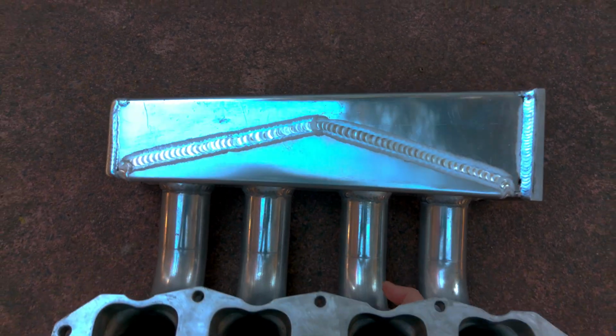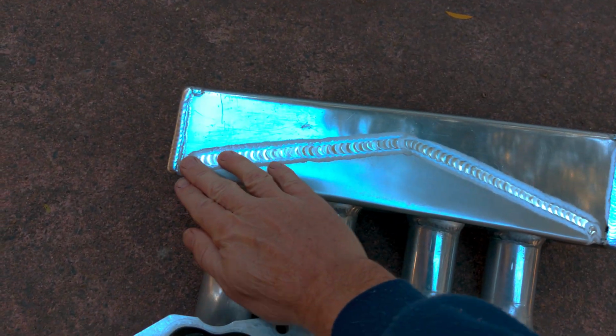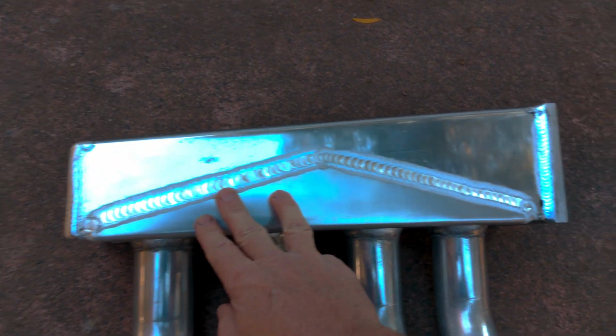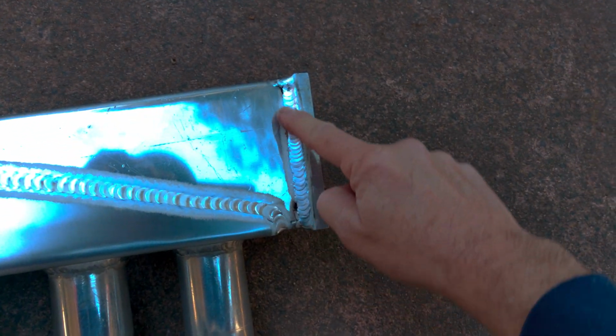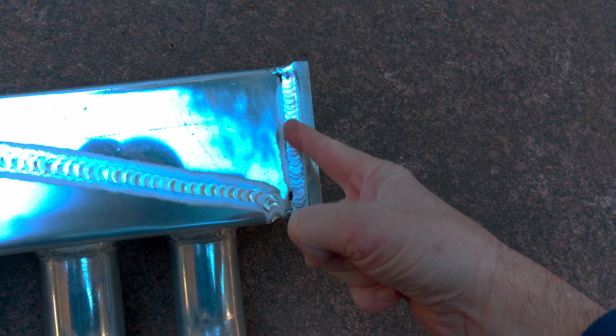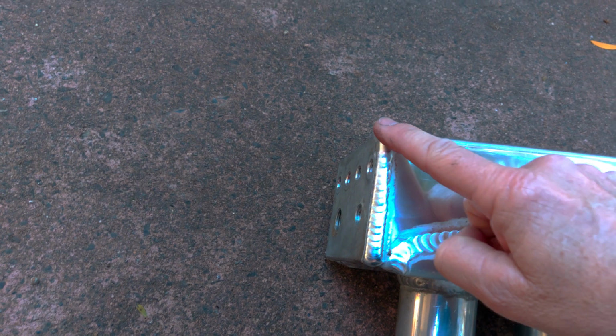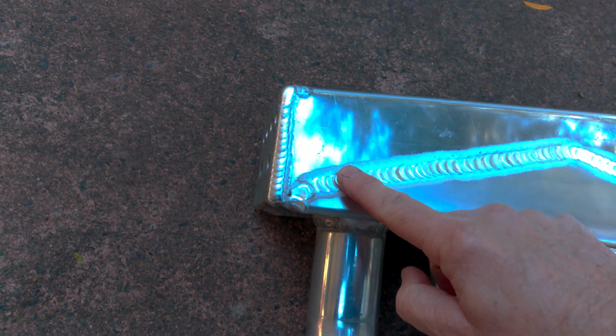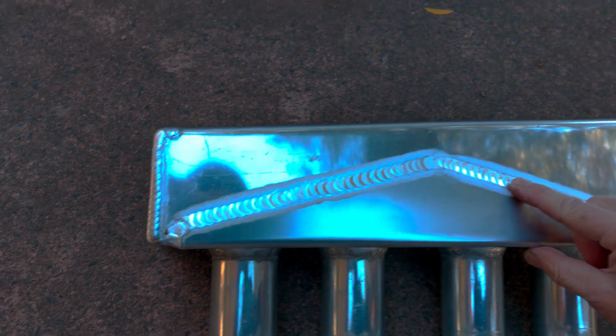Give it a bit of strength. Once again, a nice triangulation there. But we also found that there were some cracks here too. All right, there was a hairline crack through the weld there, which we had to repair, and there was another crack down here as well, which was going to open up over time, considering that we've strengthened all this area here.